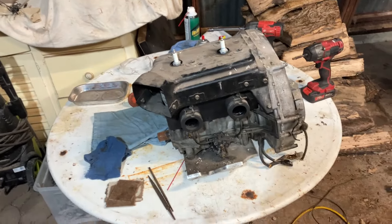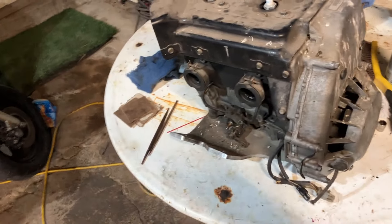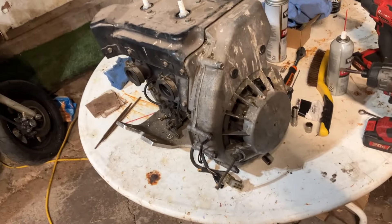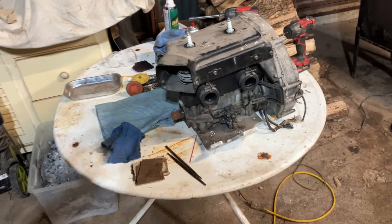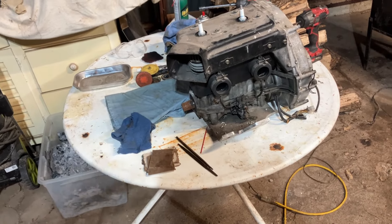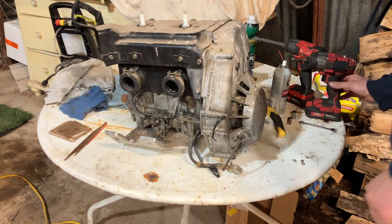We're going to get the tools necessary for this teardown rebuild and then I'll take you guys on the journey as we dive into the motor. This motor's been pulled and sitting on my garage shelf for three or four years, and I had that sled before that. Found the gasket set and crank seals, some Polaris OEM wrist pin bearings. We'll get started tearing this down. We've got to take the fan shroud off first and the recoil housing, then work on getting the motor plate off, then the top end, and keep going from there. I got a flywheel puller to get that off later.